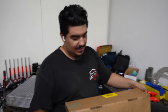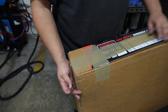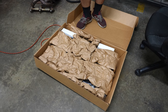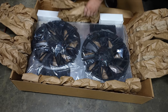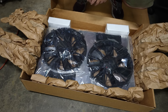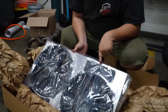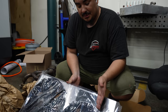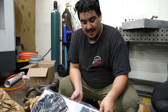He went online doing all his Googling in his air-conditioned office and was like, make it to this size — 15 inches. They had a 15-inch one in stock. They weren't very nice on the phone, but we want to show the products. I want these thick fans — they throw a lot of CFM. The cool thing about these is they have these little silicone things. When you're going fast enough, there's more air going through your radiator than your fans could actually push — that's actually what happened with the four-rotor and why the hood popped up, there's so much pressure. But these bypass the fan when that happens — not just open, but the silicone flap releases. And when the fan's on, it's creating suction so this is actually closed.